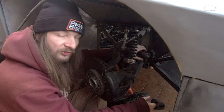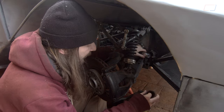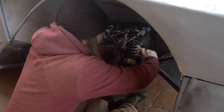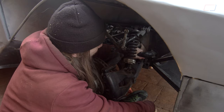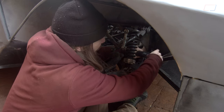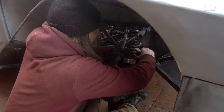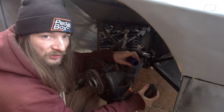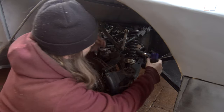In my left hand I've got the other half of the contraption — connected to all of our onboard coolant lines, plumbed all the way back to where the fuel tank is and further. The part missing is this little elbow that sits on the front of the hard line. If I get it down and rotate it around, you can see it matches up to our radiator outlet quite nicely. We don't actually have a piece of 38mm hard line to go in there, so we're going to do something a little dirty just to hold it together while we order the right parts.